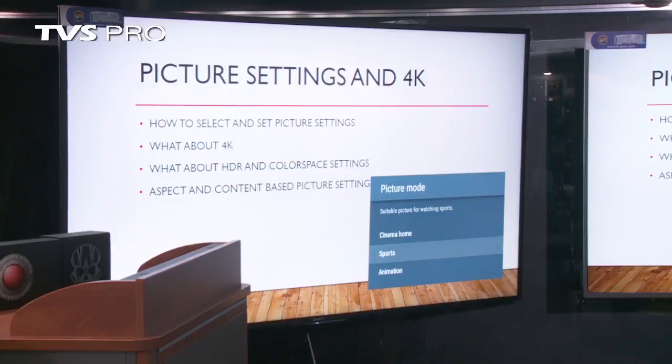If you're watching a sporting event, you can switch to sports and the TV will automatically set the brightness, contrast, color level, tint — all the settings pertinent to getting the best overall experience for that event. There's animation mode, and if you're watching photos there are different scenarios. If your children or yourself are playing games, it'll set a higher frame rate and make colors and sharpness a little better. For graphics mode, if you're running a computer into it, it sharpens up edges and adjusts brightness. Then there's HDR — if you have a 4K source with high dynamic range encoding, the set can decode this and you can put it in that mode for the best overall performance. For now, I'll just leave it in standard mode.